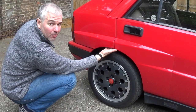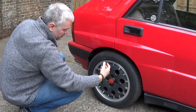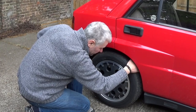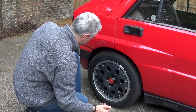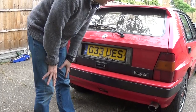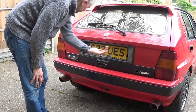Also up through the wheel arch skin itself on this side, they tend to get hold and they tend to go. The bottom of the sills running alongside the wheel — look at the way the wheel arch skin is joined up, look at that join quite carefully, and the bottom over the back of the sill, definitely where the boot meets the wheel arch and all the way under there. Tailgates can go pretty much anywhere — look around the seals around the bottom, open it up and have a look underneath.